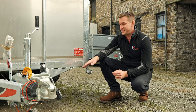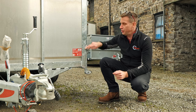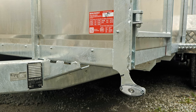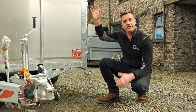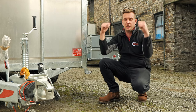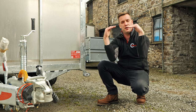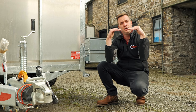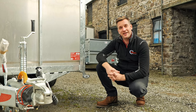Along with the welded chassis all the way back through the trailer, you've also got the welded front hoop — so the front hoop and the back hoop are actually welded to the chassis. From where the leaf springs join straight to the top of your roof is a fully welded construction. If you've got other trailers you might notice that the uprights get flex in them over time, whereas the Nugent is welded at the bottom on both the front and back hoop, so you don't get that fatigue over time.